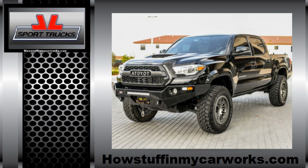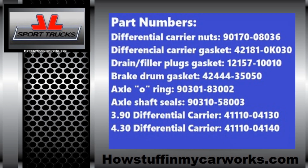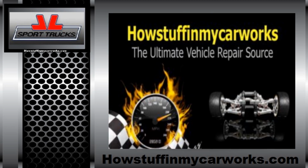leaks. You shouldn't have any leaks either at the differential carrier or at the axle shafts if you did everything correctly. Plus, if you bled the brakes correctly, your brake pedal should feel normal and not spongy. And there you have it, my dear friends. Those are the steps needed to repair the rear differential carrier oil leak common on 2016 and 2017 Toyota Tacoma.